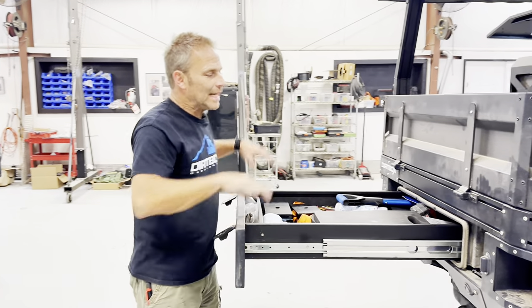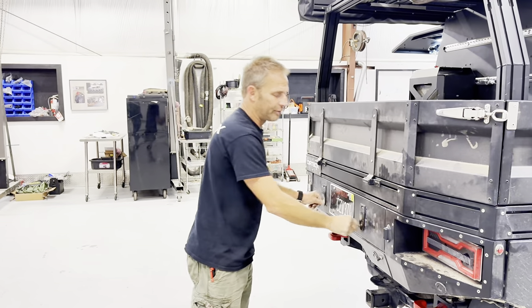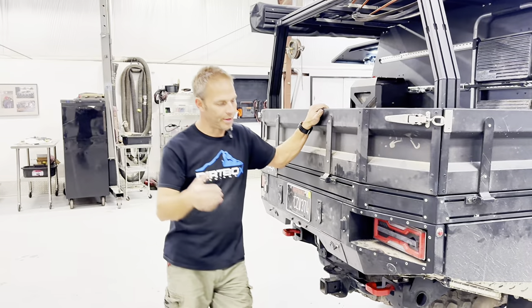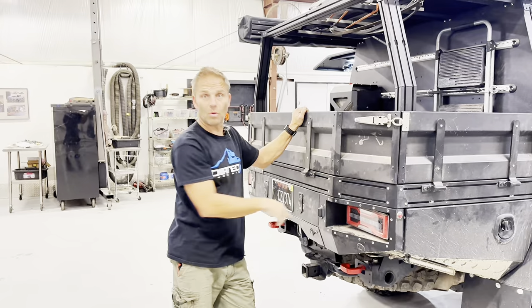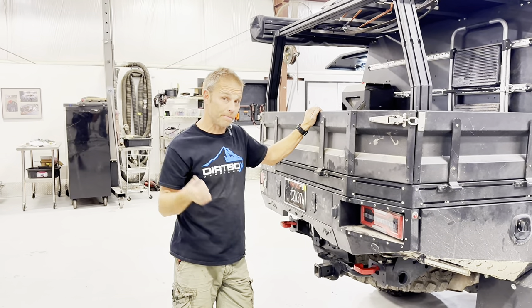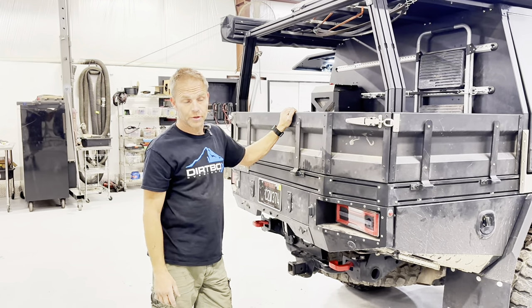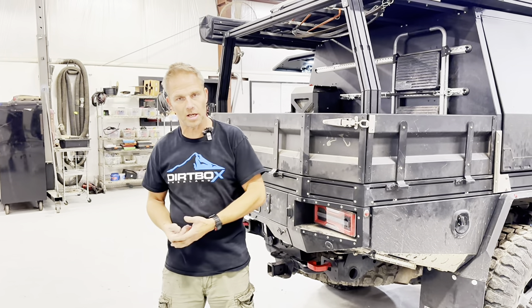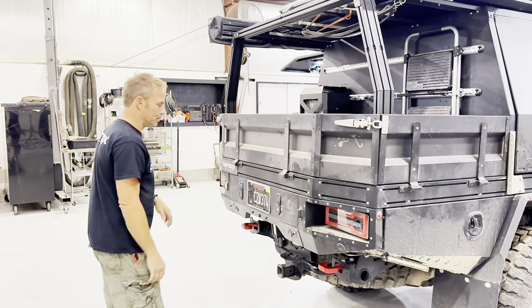Directly ahead of this toolbox or slide-out drawer is a 21 or 25 gallon baffled stainless steel tank with an incorporated water pump on it. That's going to be one of your heaviest pieces, so we keep it to the very front. This drawer is an entirely sealed case — it's not just a drawer riding on rails under the flatbed. A lot of you will ask about weight: this flatbed with two toolboxes, the slide-out drawer, a stainless steel baffled water tank with pump, and the headache rack but without the bed sides is 505 pounds. That can vary depending on cross member configuration and wheelbase.